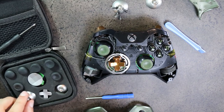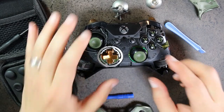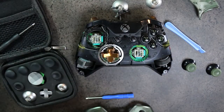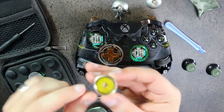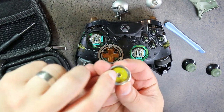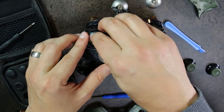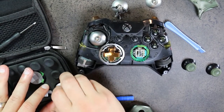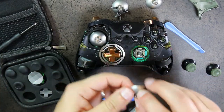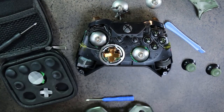In this case, we're adding joysticks. Simply pull up one stick and then the other. Joysticks are now ready to be upgraded. You do want the good stick with the protective piece on the back. The direction for these is up and down when inserting. Literally place it in on one side, then the other. For the right stick, there's nothing magnetic behind it to worry about. Both sticks are ready to go.